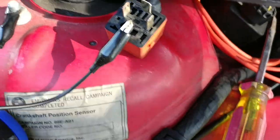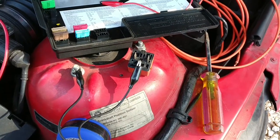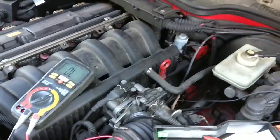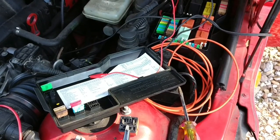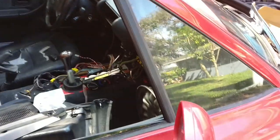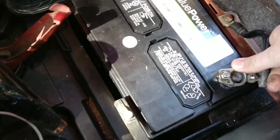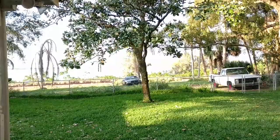So we know the relay works, which means either the fuel pump is bad or that relay is not getting the signal to turn on. In conjunction with the fact that the starter is not allowing the engine to turn from the key, I'm going to presume that the immobilization system is fighting us. I'm going to lock the car, because one way this immobilizer works is it detects whether or not you used a key to unlock the car.